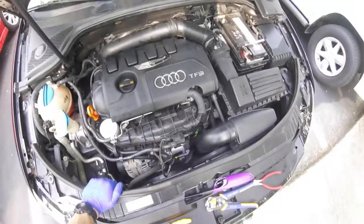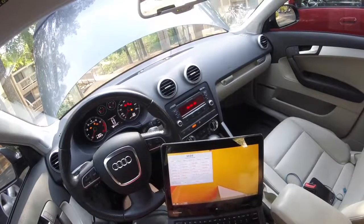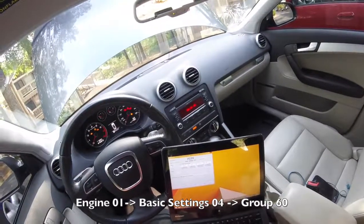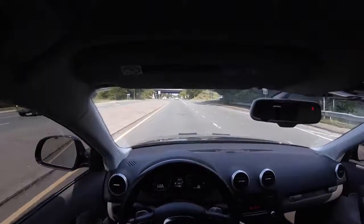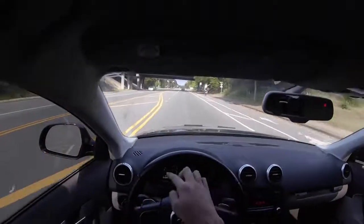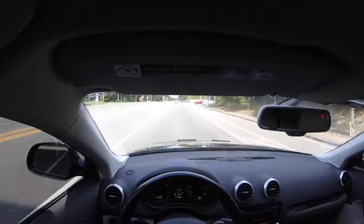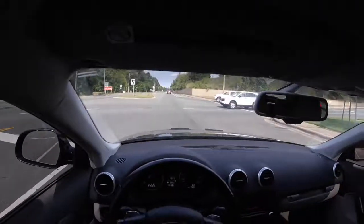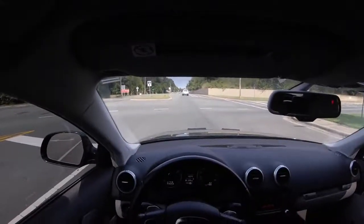With that all together, let's do the adaptation. Going into VCDS, I'll select the engine and in basic settings do a basic throttle body relearn — group 60. It says adaption okay. Out on a test drive now — everything seems to be good. ESP and traction control lights went off; once you drive about 10 feet they'll go off, they always come on when you take the battery off. Hopefully this solved my problem. With the new throttle body and the new harness, I think everything should be good.